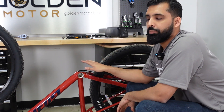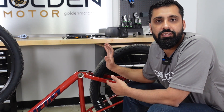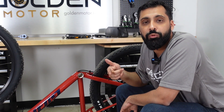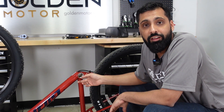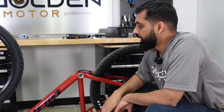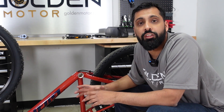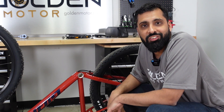So to summarize: if you have a bottom bracket inner diameter of 34 millimeters, you can put the kit in normally. If you have a press fit 41 millimeter inner diameter, Lecky has a kit for that. And if you have a press fit 30, there's another adapter so you can put it on your bike. That covers the most common questions we get regarding bottom brackets. If you have any questions regarding this video, just comment below and hope to see you guys next time.